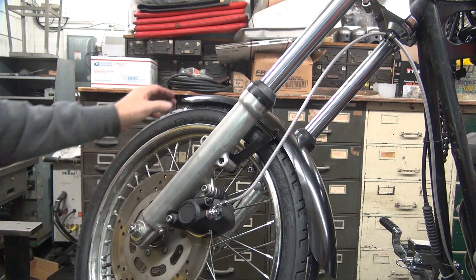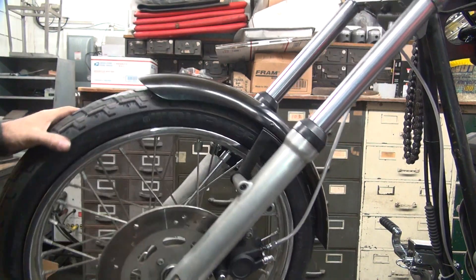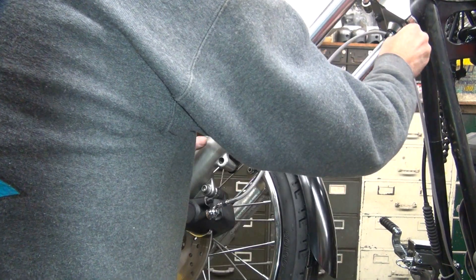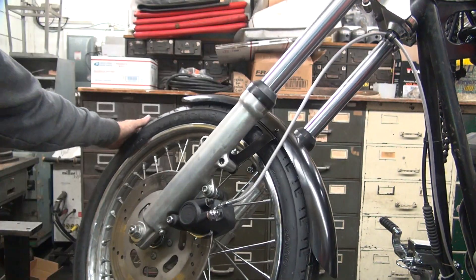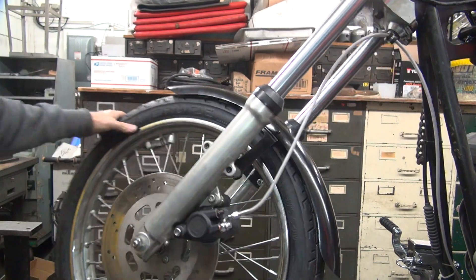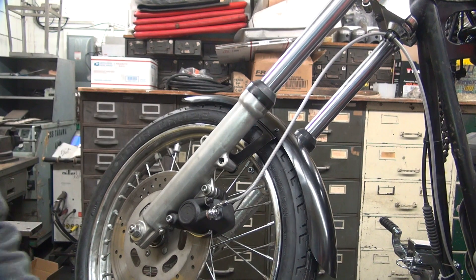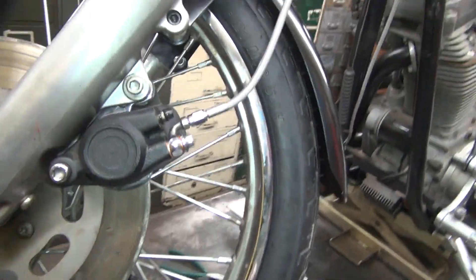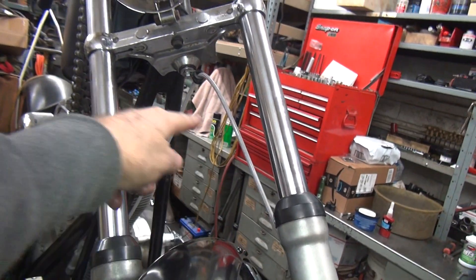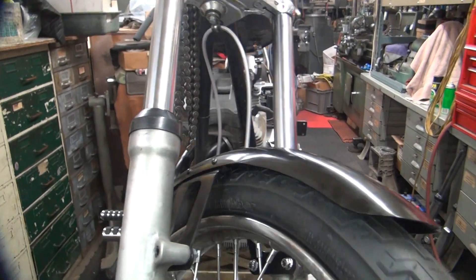You don't want to be bending on this - avoid it. Right now I've got enough slack and everything so it can go all directions. This is our tightest position right here. Do this a couple times and it's going to find out where it wants to sit. Go back to your tight spot and make sure we have enough room to go up and down. All looks good. I got the bleeder screw tight, I got that really tight, and I put the right twist in the line. The line is sitting nicely - see how it stays with a nice straight curve.